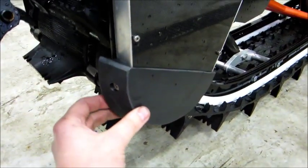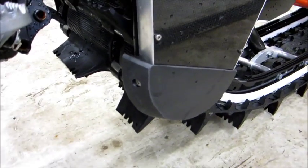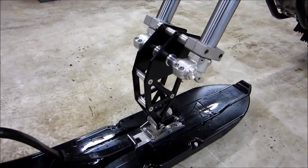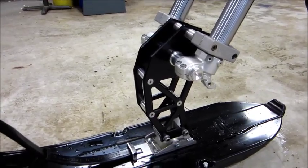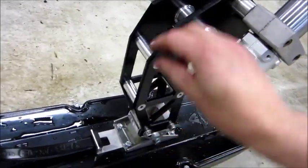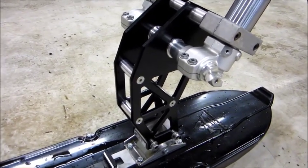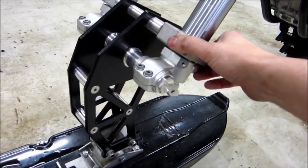The plastic cover down here is nice in case you hit a stone or stump. Up front we have a new style of ski mount that we think is as strong as the Timber Sled. It's made out of 8 mm water-jet-cut aluminum, and it's quite simple to manufacture — you simply bolt it together. The clamps are just regular hydraulic clamps for hydraulic tubing.